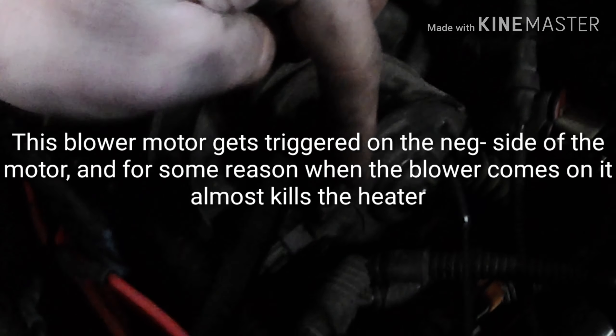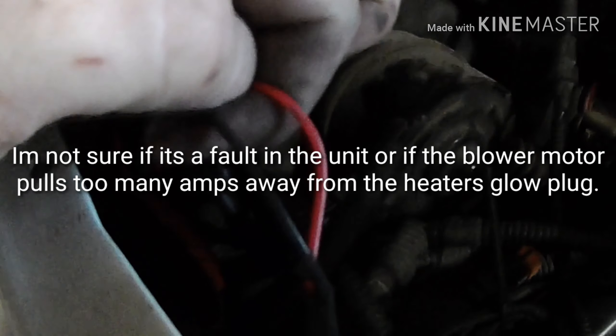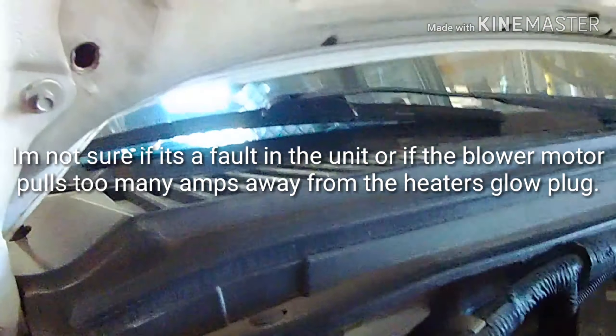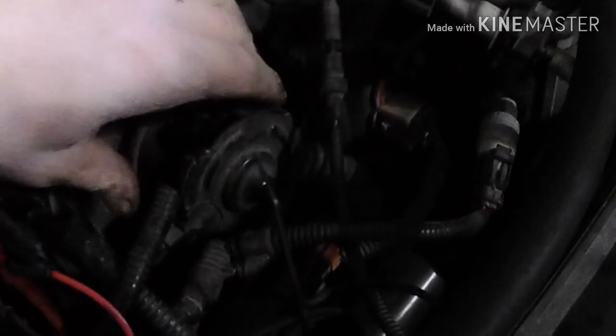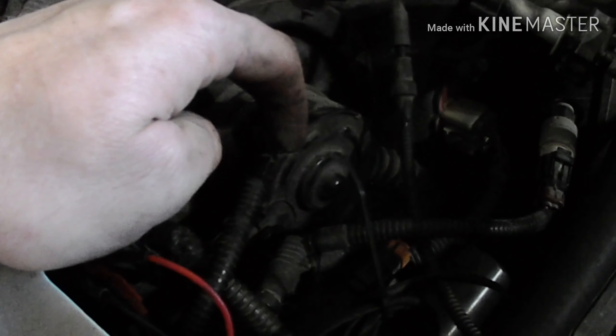The kit also came with another small wire — it's got ones with a fuse and relay, and this one just had two bare wires with no explanation. I looked it up and it said it goes to your heater box. I wired these in, spliced in with my power wire going down to my blower motor, and made sure they're not powered all the time. Once it hits a certain temperature, these two wires become powered and kick the blower motor on inside the truck. After the engine gets to temperature, it'll blow some warm air in there and heat the cab up.